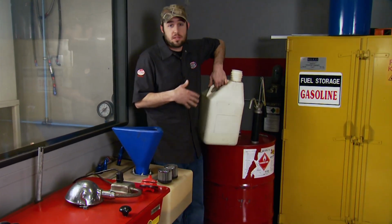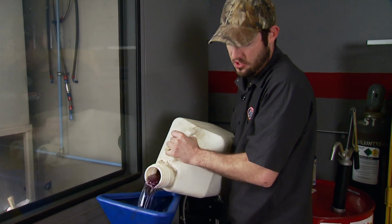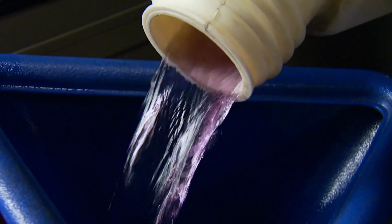High-octane race fuel lowers the burn rate in the cylinder the same way as retarding timing. So what we're going to do is mix some 110 and 93 in a 50-50 mix. We'll watch our air fuels and listen for detonation. If we don't have any detonation and the air fuels look good, we won't pull any timing out of the motor to reduce any power.